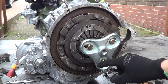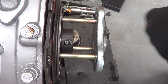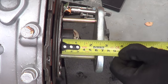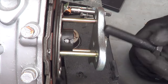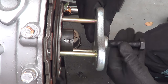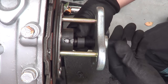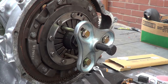When this is on, we need to make sure that it's not twisted - it needs to be straight. We put that on there to the edge, that is just shy of 620. Spin the engine round, take your big bolt that screws in there. This little device stops the engine spinning - that slides over the end. Now we look like we're in a relatively good setup; we're going to need to wedge something in here.